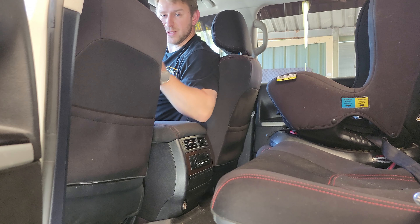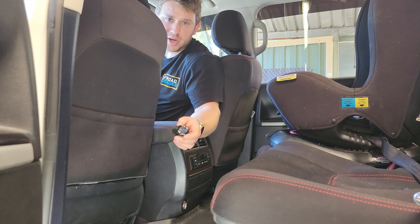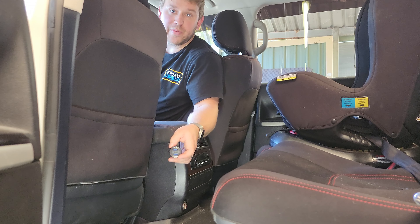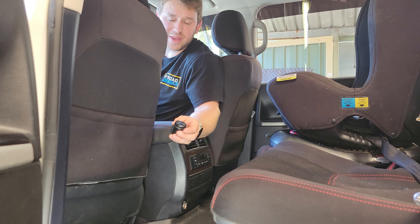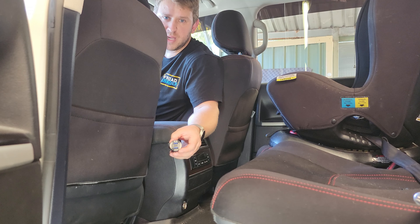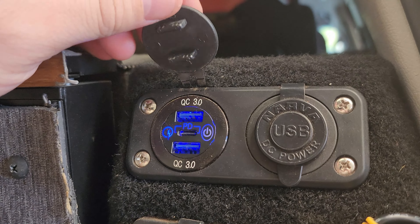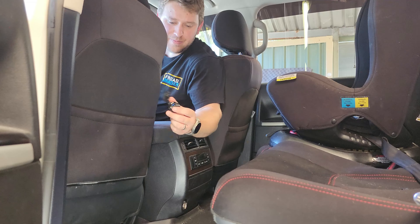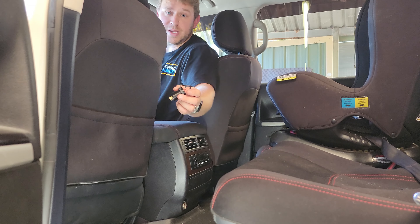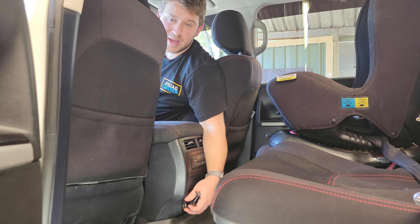I think it could be a little bit better, so we're going to install one of these. This is a USB charging port that I got off eBay — I'll put a link in the description below. I have run one of these in my drawer system in the back of the car and it's fantastic. It's got two USB outlets which are QC3, so super fast charging, as well as a USB-C charging port. It is round and it fits exactly where your cigarette port could go, however we are going to install it in addition to this, so if for whatever reason I do need a cigarette socket port, I do still have that option.